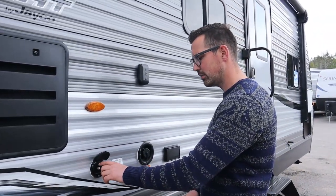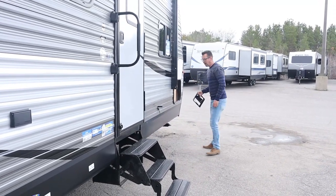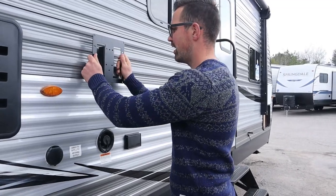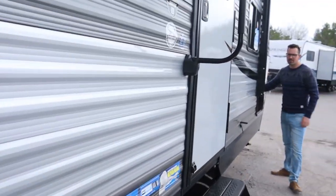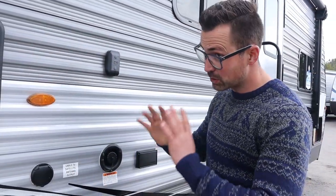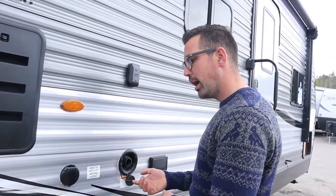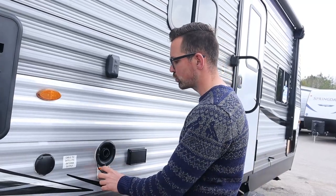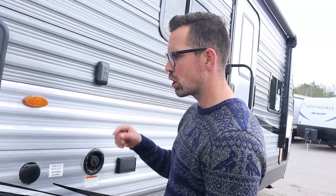Fridge vent and furnace vent — don't touch them. Outside TV hookups are right here along with cable, satellite, and TV antenna connections. On the J-Flights there's a TV bracket you can screw to the back of your TV that locks into place for an outside TV. The outside receptacle is attached to the GFI inside the trailer, so if it's not working, the GFI inside is likely tripped. The fresh water fill is here — stick a hose in to fill your fresh water tank; when it's full it'll splash back out. There's a drain directly below to empty the fresh water tank.